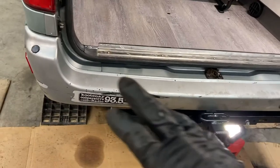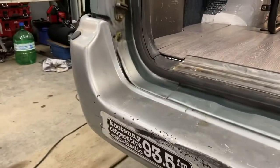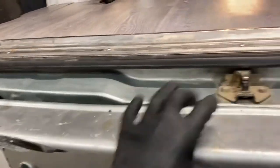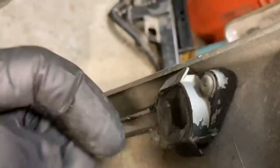I tried to remove the skin from the sub-assembly. Once those two Phillips screws are loose, you remove the four M12 bolts from inside and the bumper will just come off. You have to pry off the corners — the male side fits into the female side, top and bottom. Pry them open with a screwdriver or just pull by hand, and then the whole thing will fall down.